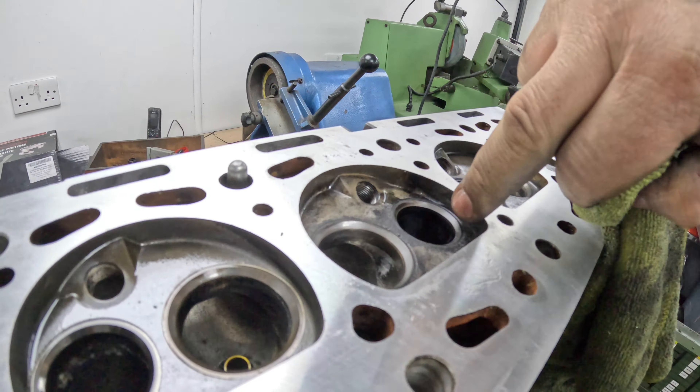That's it for tonight — I'm going to crack on with that tomorrow and cut the seats. The Peugeot head is now mounted onto the Centronic and I'm going to cut all the seats. The two I tested are out. The seat has spread because it's grinding in certain spots but not touching in others. There's no point trying to grind them all in — I'd assume they're all the same. It won't be right if I just cut two, so since I know two are wrong, I'm going to cut all eight.